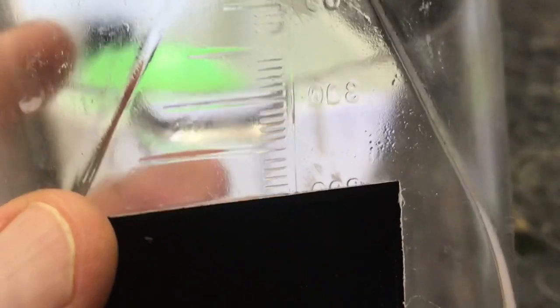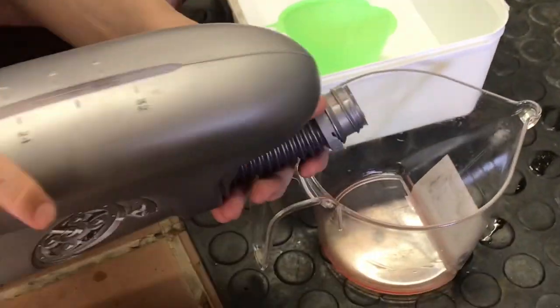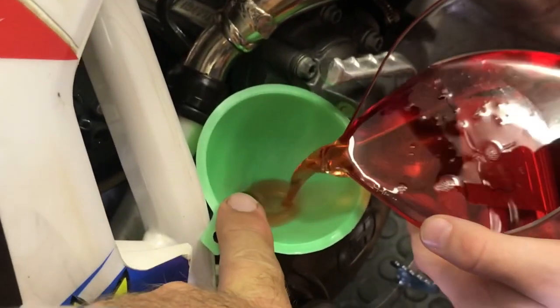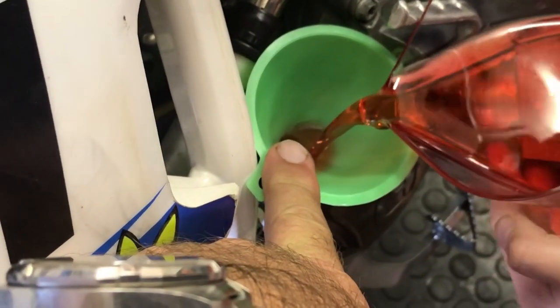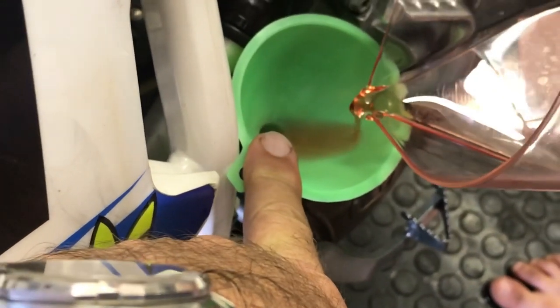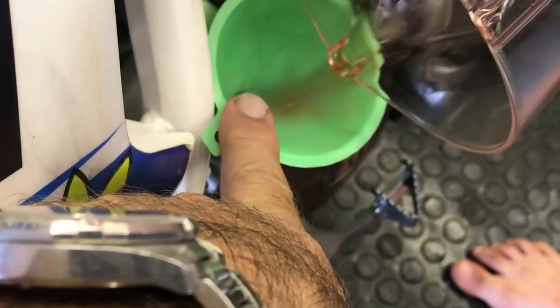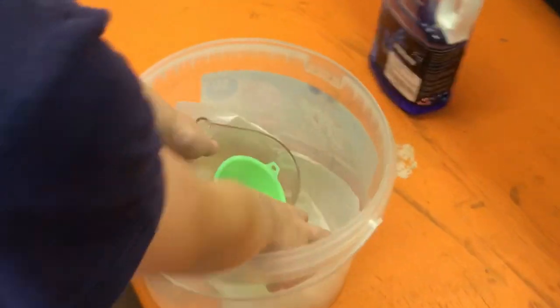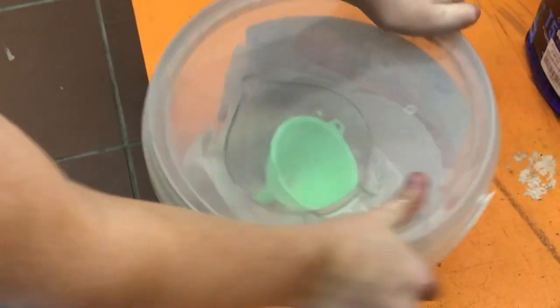We still haven't put the oil in — that's why it's a good idea to have the oil filler cap off, to remind you that you still need to put your oil in. Travis is going to show us how to fill up the bike with oil. Our jug is 200 mils — it's quite difficult to read, so I put a piece of black tape at the 200 mil mark so it's easy. We're putting 200 milliliters in — that's all they take. Travis holds it there to get every last drop out. The oil goes into a dustproof container used just for our Motrix. Right — there we have the 50cc oil change done.